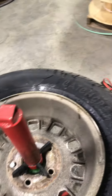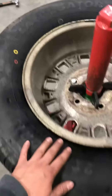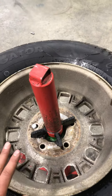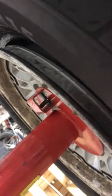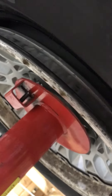Now just with your hand strength it's really hard to get the whole thing seated, but you want to try and get as much of it done — looks like I got about half of it here. You want to get as much seated as possible. You're probably wondering why it doesn't look too bad, but then you come around underneath and you see this absolutely gaping hole. No matter how much air you throw at this thing, it ain't gonna seat itself at all — my whole hand goes in there.